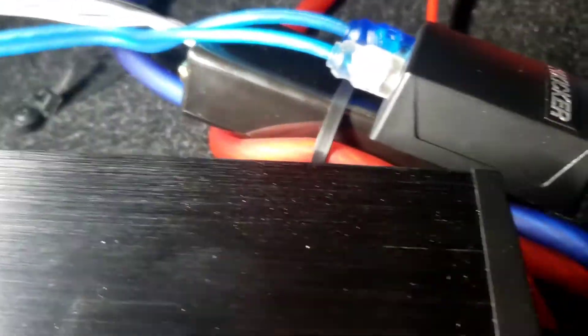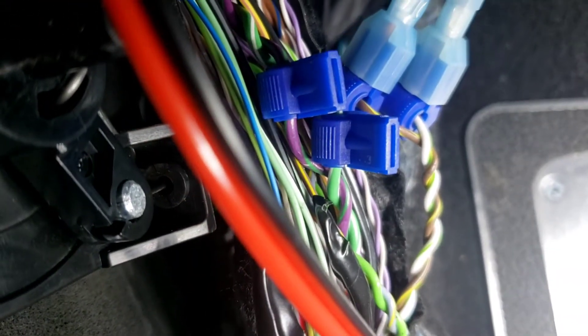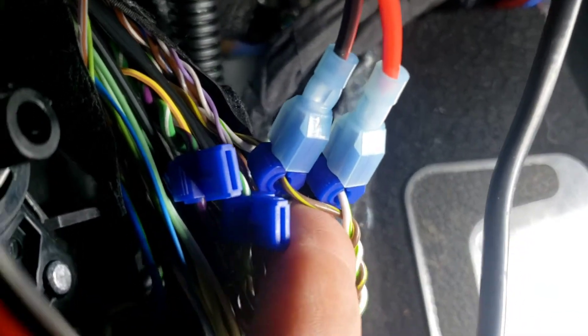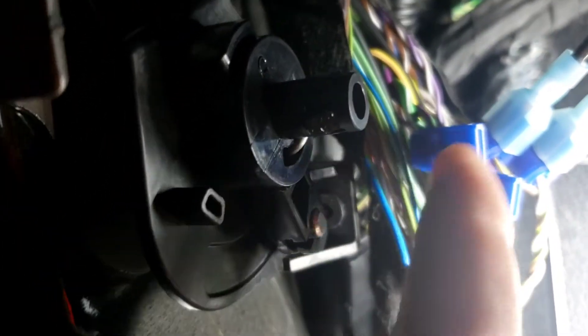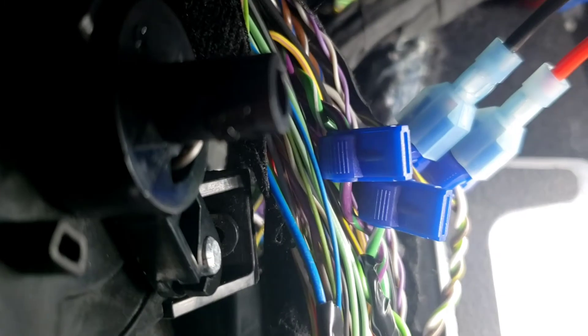I'll clean this up and make it neat after the video. Also, over here — you can see there are two sets of wires. You don't want to hook up to the green-white and purple-green; that has too much power for the high-low converter. For the line out converter, use the left rear: white-green to positive and brown-yellow to negative. If you don't do that it will not sound right — I tried it at the sub and it didn't sound right, so I had to redo it.